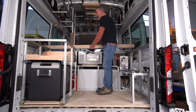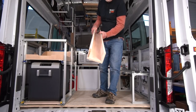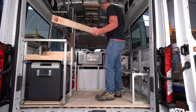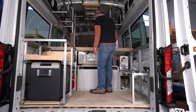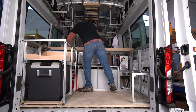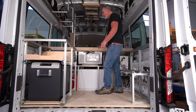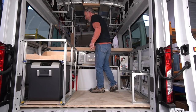I built what I call the wire trough. This is basically just a three-sided trough — a place where I can lay in my wires and pipe and get from one side of the van to the other. It's shorter than the distance of the bed crossbeams so that the wires can come up one side, travel across, drop down, and continue on their way. Once I decide where I want to put it, it's very easy to attach it to the top of the 80-20 bed rails.